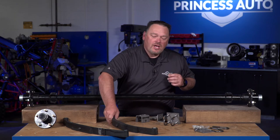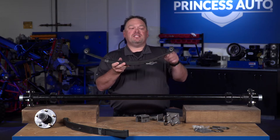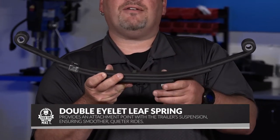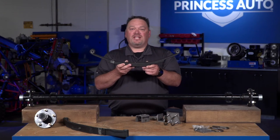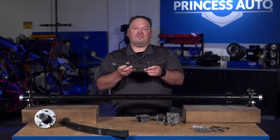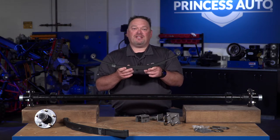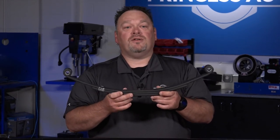The next step after selecting the axle is your accessories. There's a wide range of accessories available. The first one: you've got to figure out what type of spring you want. This is what we call a double eyelet — it has two eyelets and a certain number of leaves. The more leaves you have, typically the more weight capacity you'll have for that trailer. But the kits are dedicated to a couple of different models of axles, so if your axle can't handle that weight, going higher on your leaf spring doesn't mean you'll gain that capacity. For a straight axle, you'll need two leaf springs — one for each side.